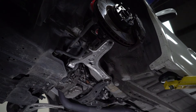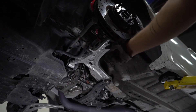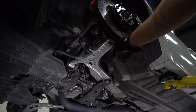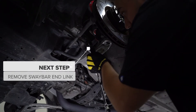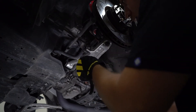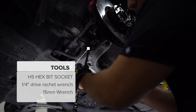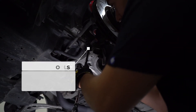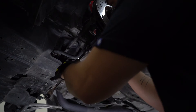We are going to remove the sway bar end link, or detach it from the control arm. Once we detach it from the control arm, all we'll have left is this little castle nut right here. We'll be able to take this cotter pin out just with some needle noses or some little clippers. We're going to put the wrench over the bolt like this, make sure it's set to loosen the nut, and take this guy here, make sure it's set to tighten, so they're not both spinning in the same direction. Then we'll insert a little hex into the sway bar and start turning.